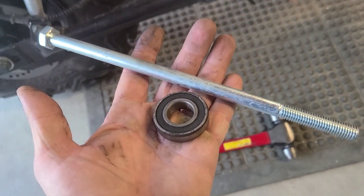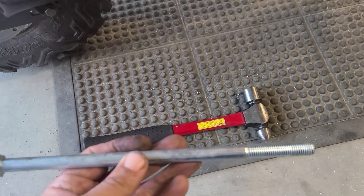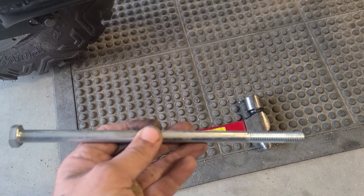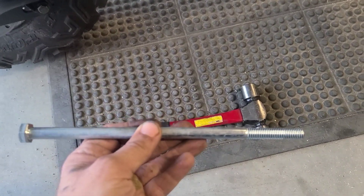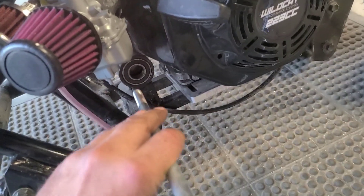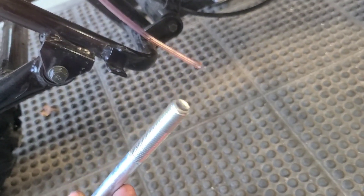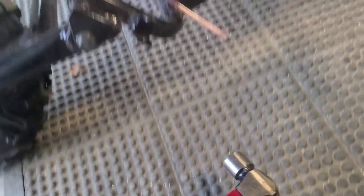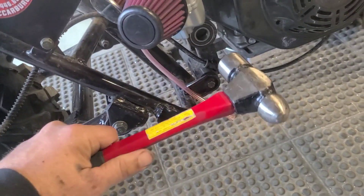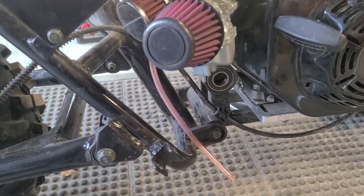I got one out. Now I'm on the other side of the bike. I think this is a Megamoto axle, maybe a doodle bug axle or something, and you have a lot of room. You pretty much want to use the most blunt object that'll fit in there, so when you're giving it the rapid tap you're not completely minging up the bearing.